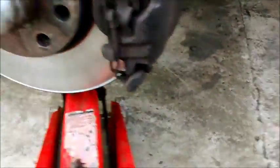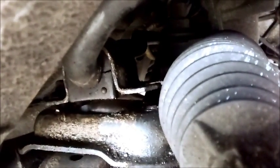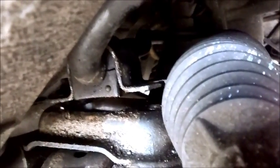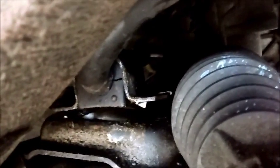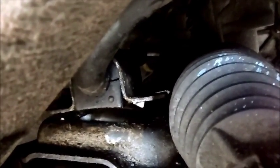So with that one bolt removed, what I should do now is just jack up the wishbone. So that's lifted it off the sub-frame now, giving me a little bit of space to then push or pull it out. Just notice the split in the actual rubber itself - it's facing towards the front just as it is on the other side. You should re-align it that way. There's really only one way you can put them in anyway because they've got orientation bumps on them.